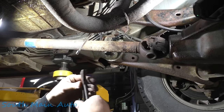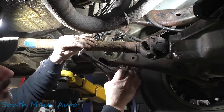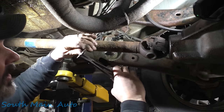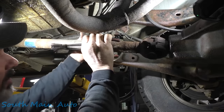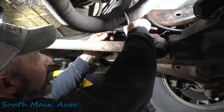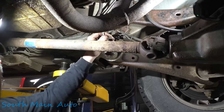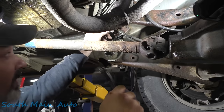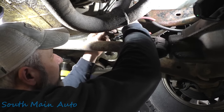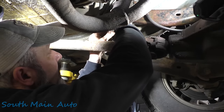We're gonna need a little bend on the end. So we're gonna grab a hold of this little fella. We're gonna need a wee bit of a bend that direction there. We're gonna give this a couple bends of how we think we need it. These are some brake line bending pliers. These ones are for 3/16 line, and that's exactly what we're using. We just kind of want to manipulate this around how we see fit.